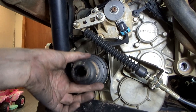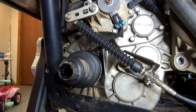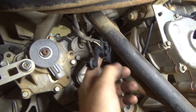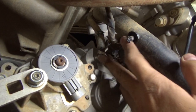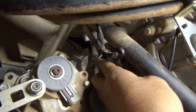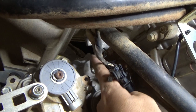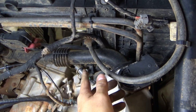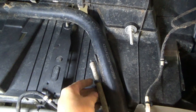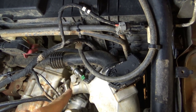While I was taking the axles out, one of them didn't want to play nice so I just left it in — it'll be easier to get out once I take the transmission out. This connector here does not need to be unplugged; it was just pushed into that little hole, so you just have to take it out. As for the vent tube right there — instead of taking it off on this side, because it's super long and goes way up in there, it's easier to trace it to the other side and take it off there, then fish it all the way back through.